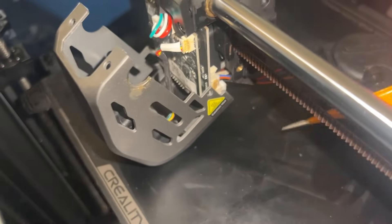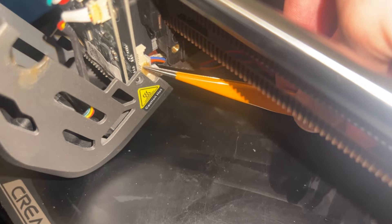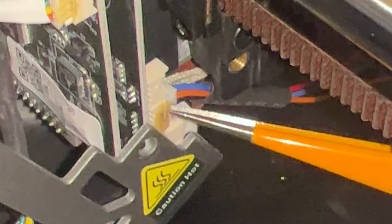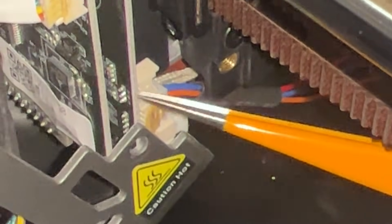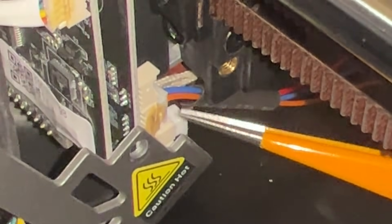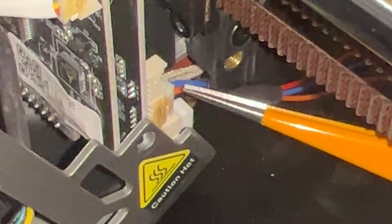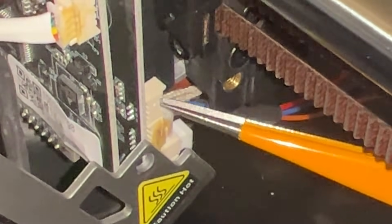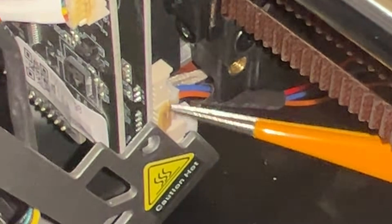So you pull it out and it can come out like this. This motor is plugged into this connector. But if you take a closer look at it, all this connector is actually glued together. So be very careful removing this one — don't pull on it. You may destroy the wire and the connector easily. Just use a tool like a screwdriver or something to apply pressure slowly to get it out.